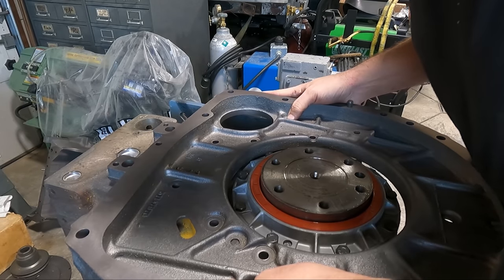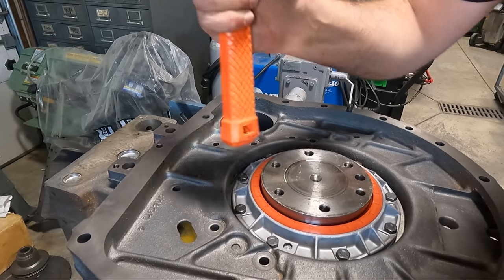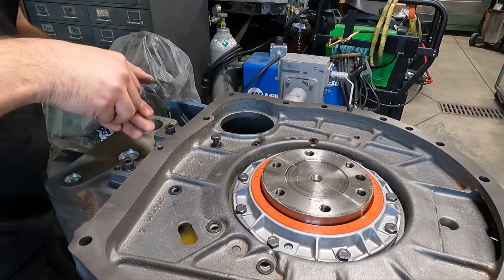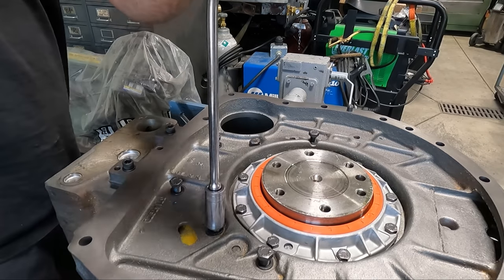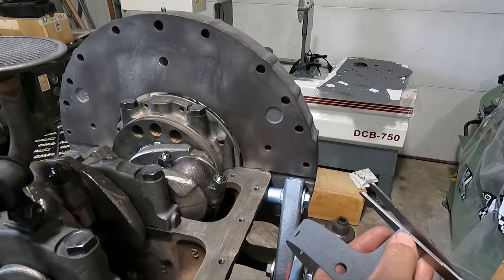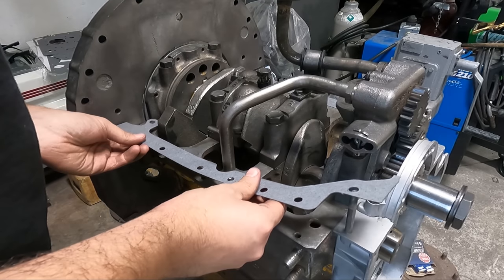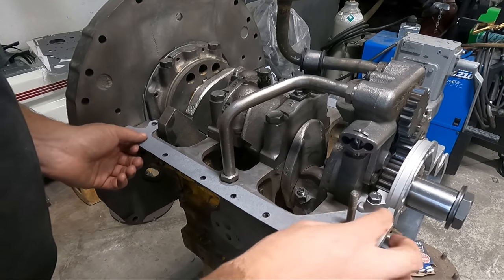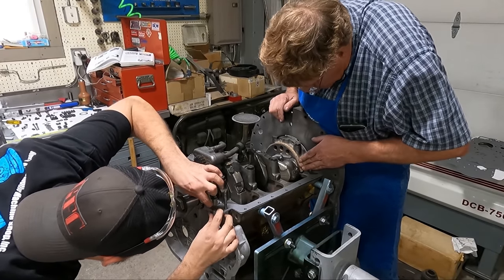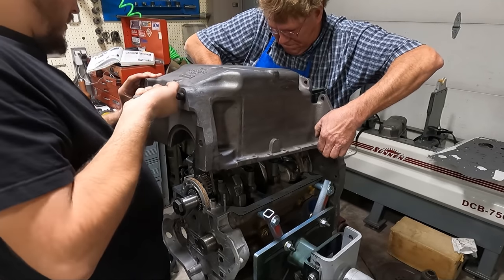Next I jumped back to the back side of the engine to get the transmission adapter plate installed to the block. This massive piece of cast iron doesn't really need to be sealed that I know of, but the last guy installed it with a layer of silicone and so did I — it's possible water could somehow leak in otherwise, but they don't make a gasket for it in the gasket set. When it comes to gaskets like the oil pan gasket, it's not uncommon to find they don't fit quite perfectly out of the box, so don't be afraid of doing a slight bit of trimming. We also recommend using a light bit of silicone sealer at the mating points of the cork gasket and paper-type material gaskets as an extra layer of comfort.